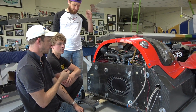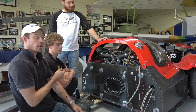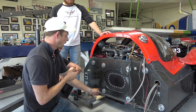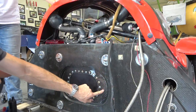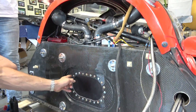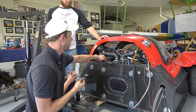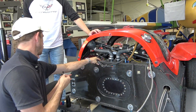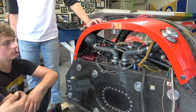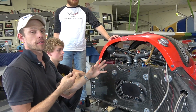I was talking with Scott at FuelSafe and they were great at helping us get everything set up and make sure it was right. So this is the carbon fiber monocoque tub — you can see the flange, the carbon, the monocoque. This is another piece of carbon, and in here is the bladder — that's why it's flexible. This bolts so you can access the inside of the bladder for pickups, pumps, and fuel foam. There's a fuel level sender that goes down and has to seal, and this is where your fuel return line, outline, and vent can be. You also have two fuel fills right here, and each one is built so that if a car flips over, there's a big check valve built into the vents so the fuel doesn't come out.